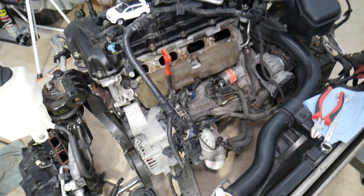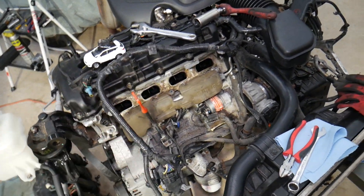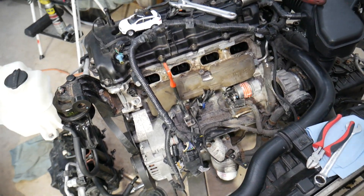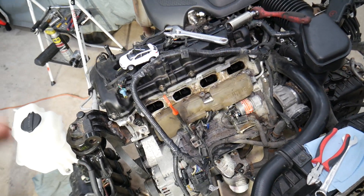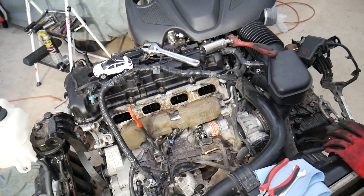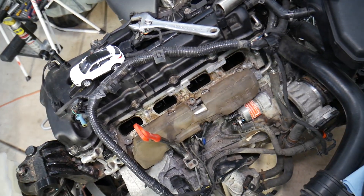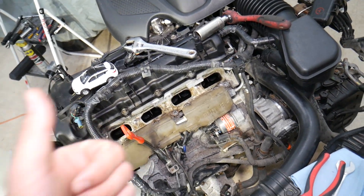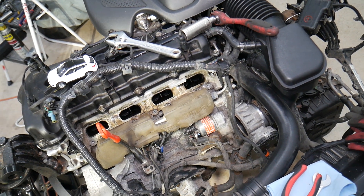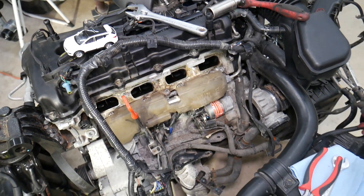That's how terrible those valves look, and it's all because of a bad PCV valve that costs just a few dollars. If you have a Hyundai Santa Fe, even your Hyundai manual will say this valve should be replaced — but 9 out of 10 people never actually replace that little valve that can destroy your engine. You can start burning so much engine oil that you think you need a new engine. Check and replace it soon before it's too late. Note: if you have a turbo engine, a failing turbo could also be putting oil into the intake manifold — that applies to newer Hyundai Santa Fe models with turbo engines.